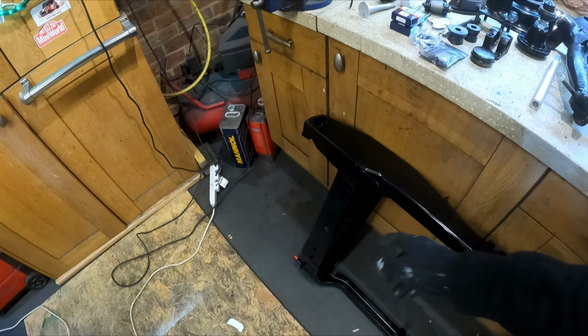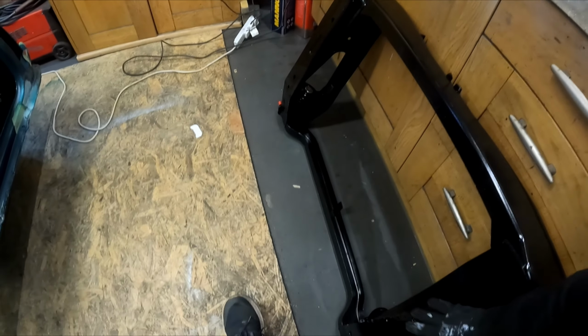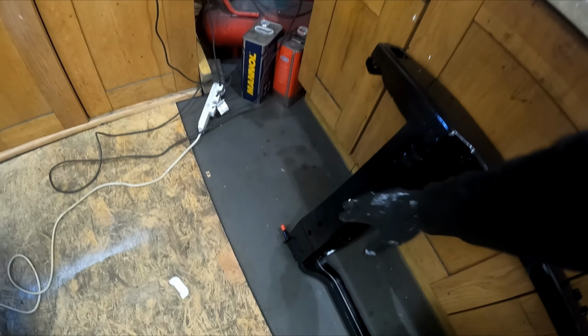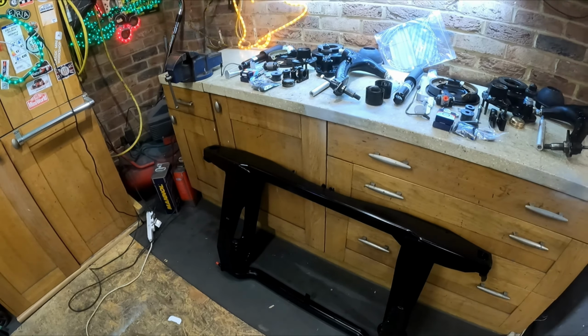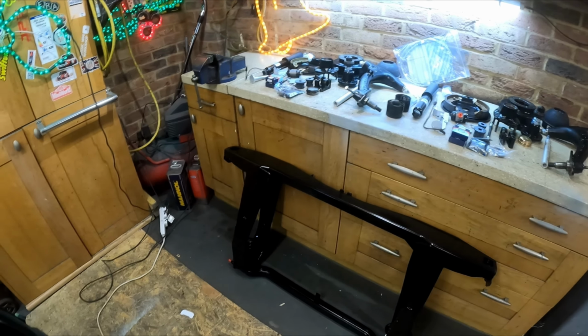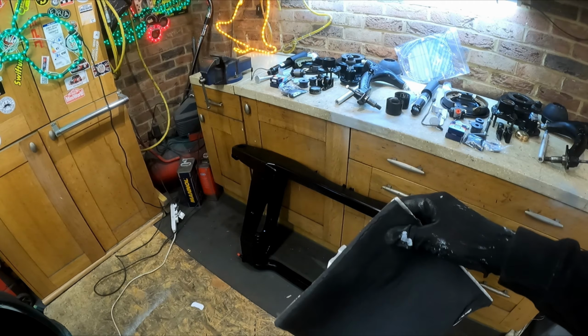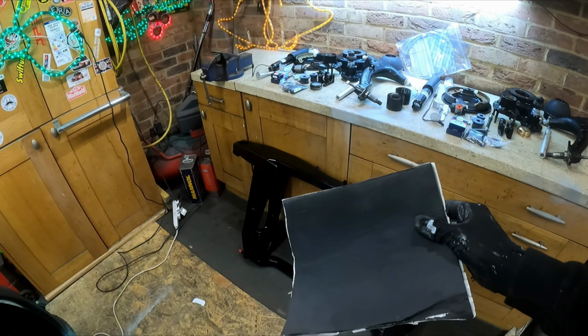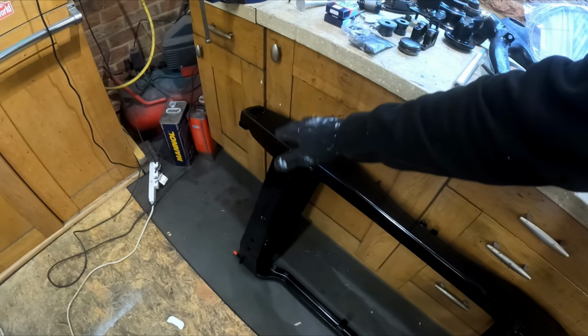I get asked this a lot. On the underside where it goes up against the floor, so actually it's this side, there are some insulation blocks that go on there. It's basically just to stop the subframe banging against the boot floor when you go over a big bump, because obviously it's all on rubbers, so it does move around a little bit. The stuff that's on there is like horsehair. The stuff that I've put back on in the past is just this. It's a bit of sticky-backed sound deadening, like closed cell neoprene. So I'll just cut some blocks out and put them on the areas where it's likely to catch.